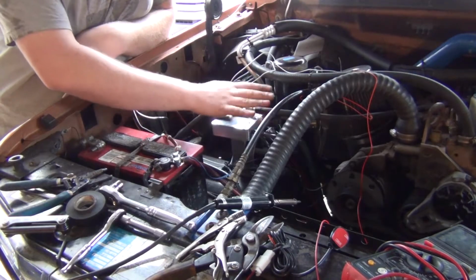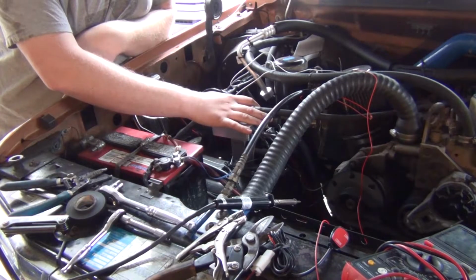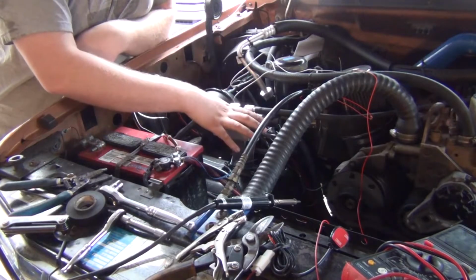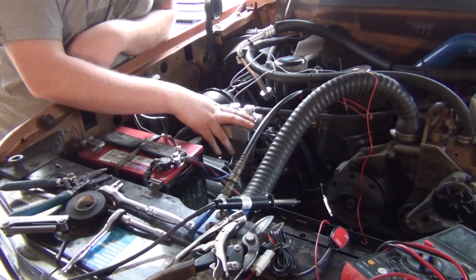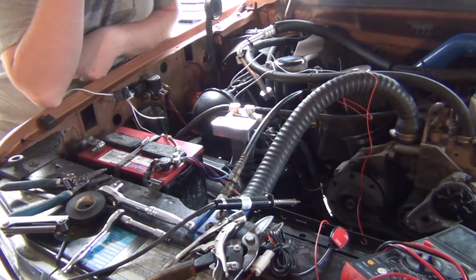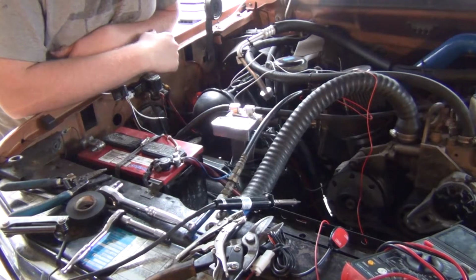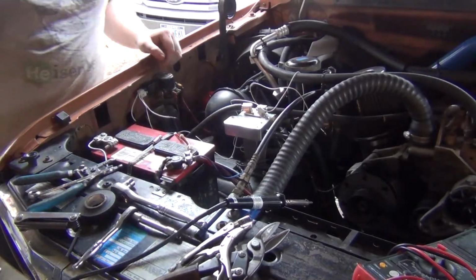And I just tested it. I pumped this up, ran this thing, it pumped up within just a few seconds, maybe 30 seconds. And I even used the brake pedal a little bit. And the HVAC controls all move yet again. And came back over and unplugged the thing from the booster and it coughed out. It went whoosh. And I did that like 10 minutes after I operated all that, so it's not leaking so far.